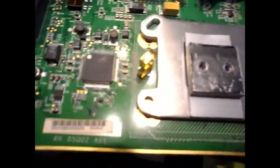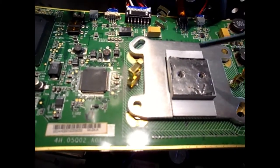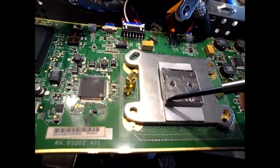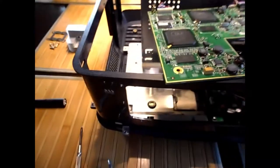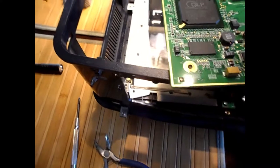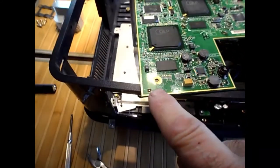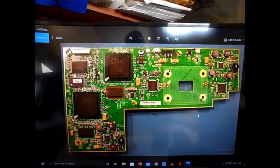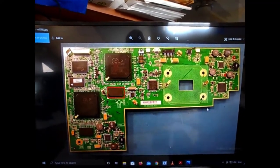What I notice is there is heat sink compound on this surface, and I can see it's definitely hardened up. So I'm going to put some more silver thermal compound on this surface. Oh, there was one screw in this board right here that has to come out before it'll come out of this big metal case here. Just that one screw. Okay, I'm going to include all these pictures in the video and a link to the PDFs, etc., in the description below.